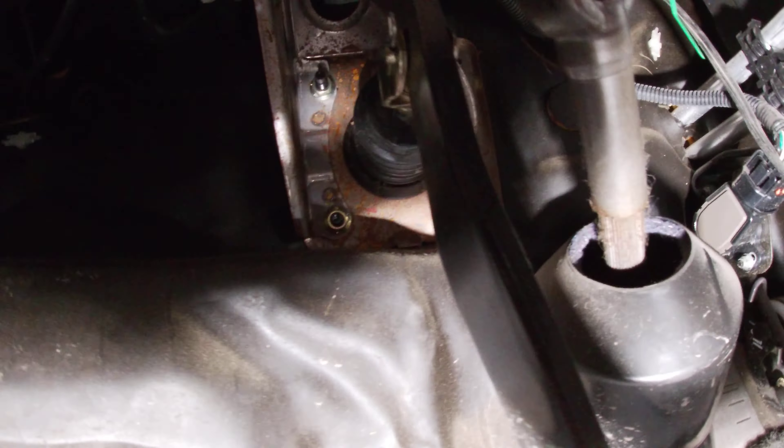There's my interior car warmer, and there's my plug to plug it in with. On mine, this is what I prefer — I just have it mounted on a piece of wood and I just leave it laying like that when it's plugged in and running. This is the intake; this is where the heat comes out. You want to keep this away from direct contact — give it some space. This is a 400 watt one and it keeps the interior of this vehicle quite comfortable when it's minus 20 below outside.